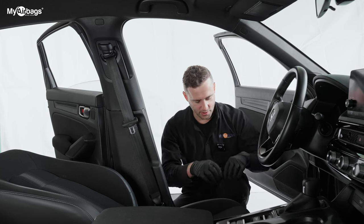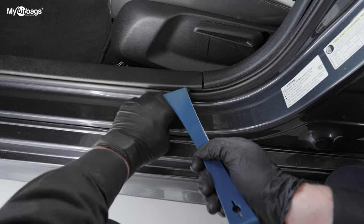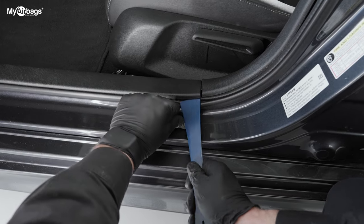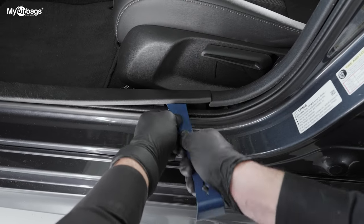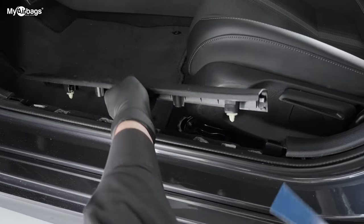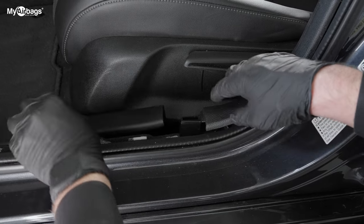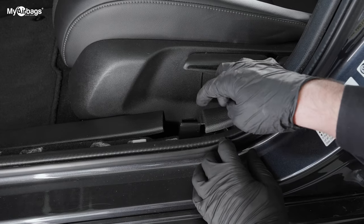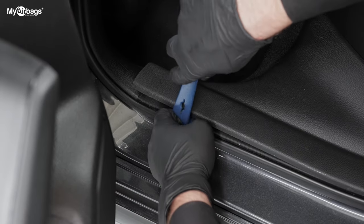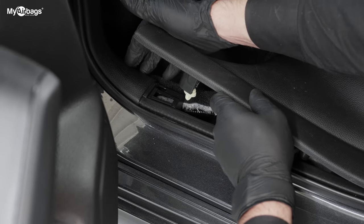At the bottom you're going to need to disconnect the panel on the foot side first, and then move this piece here — it's the one on the side between the driver's seat and the door. Just loosen it up. When you remove it you can see this piece lays on top of the pillar panel that we need to remove. You'll want to do the same thing on the rear side in the back seats. You don't have to completely remove it, just so that this panel here is freed up.